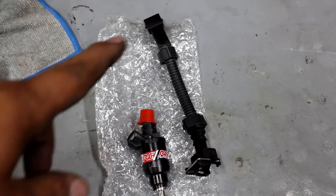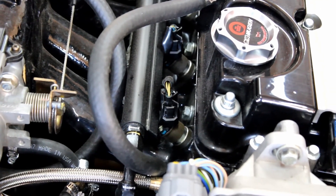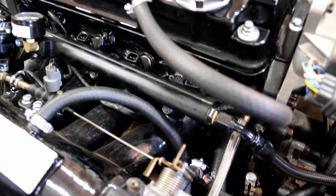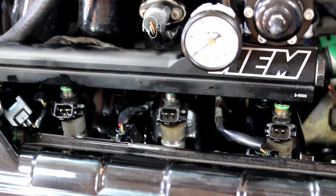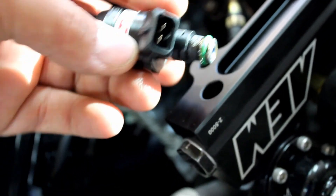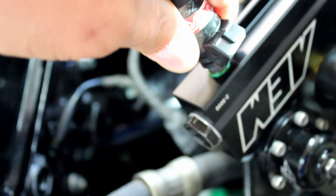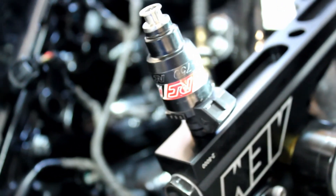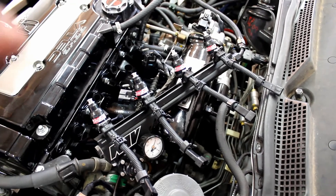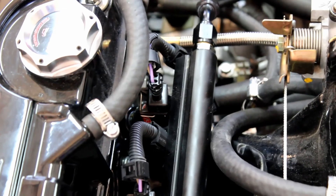To change out the fuel injectors, start by unplugging all the injectors. Use a 10mm and remove the three nuts that hold the fuel rail down to the intake, then wiggle on the fuel rail and pull up and it'll come off. Then pull the injectors out of the holes. I use a little bit of wheel bearing grease to lube the O-ring so I don't rip it — give it a little push and a nice wiggle till it goes in. If you do that without lube you could rip the O-ring and it'll leak. Now that all the injectors are in, we put on the adapters to go from the injectors to the wiring harness and bolt it all back down.